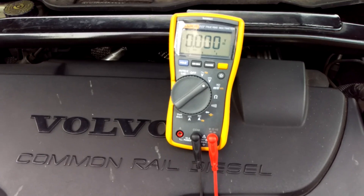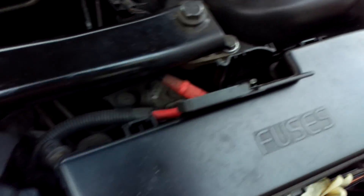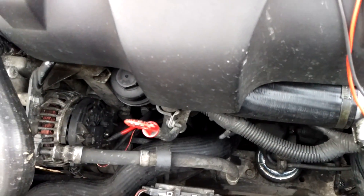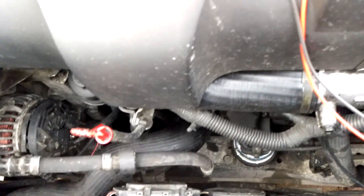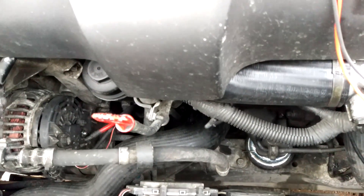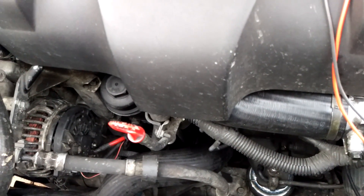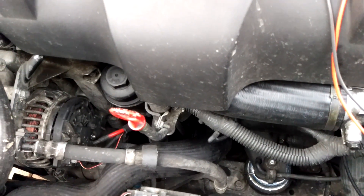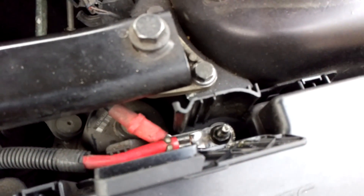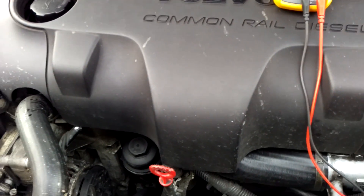Never write off an alternator just because you're not getting the figures you expect. Always check on the posts — post to post. If you've got a voltage drop between the posts, it's more than likely the connections between them. It's very unlikely you'd ever actually have to change the whole wire — it's nearly always the connection. That doesn't mean you can't have other problems with an alternator; there are any number of other issues, and I'll cover those in other parts of this alternator testing series. Just from maybe 5 to 10 minutes of disconnecting, cleaning, and putting back together — great result. I hope you find all that information useful. Thanks for watching.